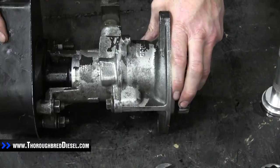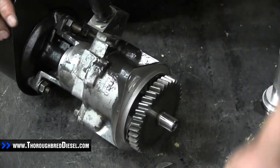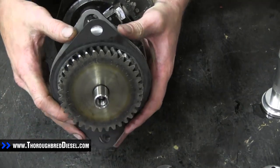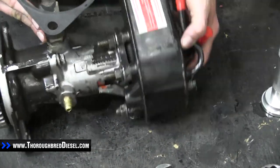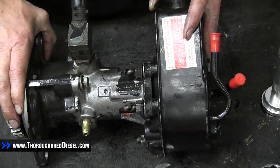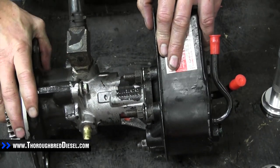Everything is good to go — everything is freed up and the pump is ready to reinstall. The last seal in the kit is the seal between the vacuum pump and the engine. When you go to reinstall it, just put this seal right back on, reinstall it, and you're good to go. This was the installation of our vacuum pump seal kit for our 1996 to 2002 Dodge. Part number is Cummins 4089742. We've got these on our website. If you have a question on this installation or any of our other installations, please don't hesitate to give us a call. Thank you.